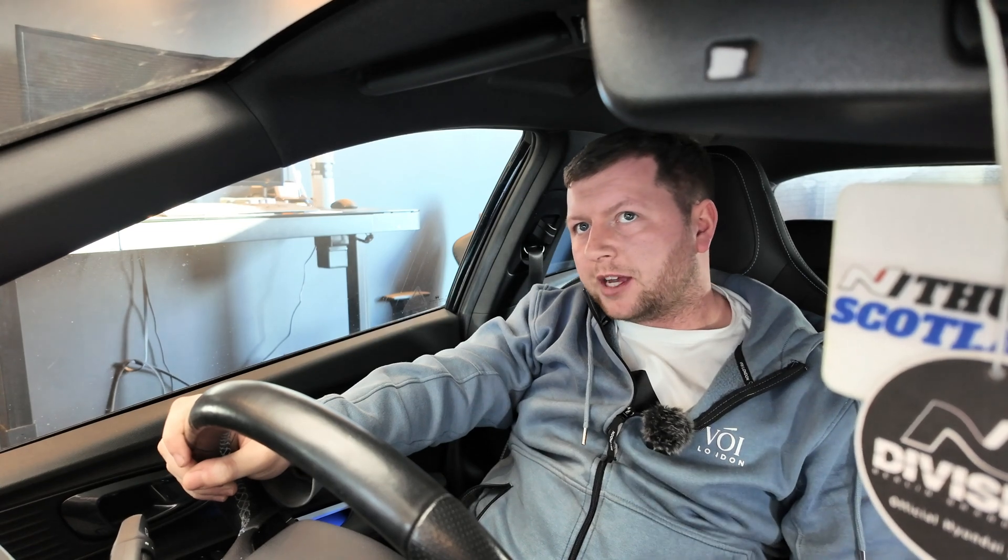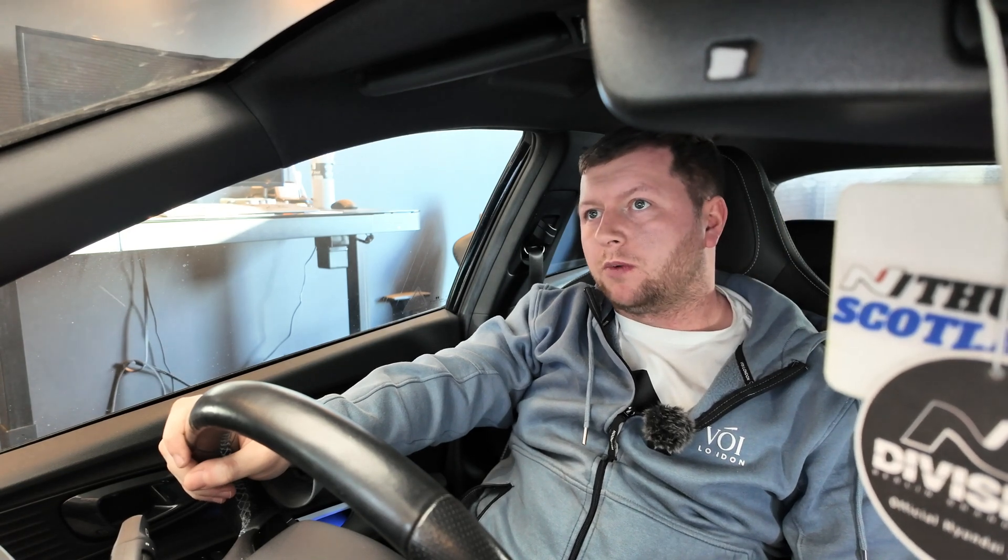The logs are a bit funky — the way the ignition goes is a bit strange. The car doesn't run a lot of boost, but to be honest a lot of cars don't really run a lot of boost, it just depends on the particular setup. 198 horsepower, 312 Newton metres. First impressions — I can see the way the ignition goes is a bit strange and if we can get that up it's going to make a difference, but we also need to get a little bit of extra boost in there. I'm going to go and start setting up for a bench read while I go through all this, and then we can make a couple of changes to the ECU to lift the torque up. We'll try and start in the torque zone first before going crazy with the top end.